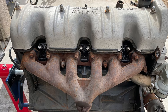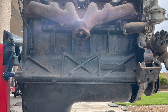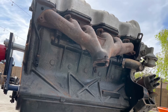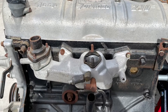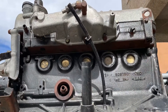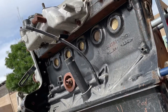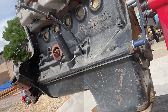Taking off the exhaust manifold was pretty straightforward — it simply just bolts onto the block. There were like 10 bolts or something. The intake manifold is the same thing, literally just bolts on, nothing special about it. The dipstick was attached to it, so you remove that and pull the dipstick. This thing had nice brass freeze plugs, so we don't need new freeze plugs at least.